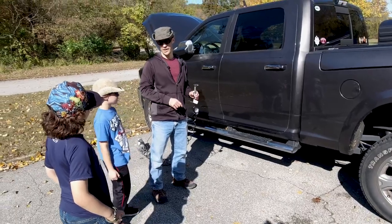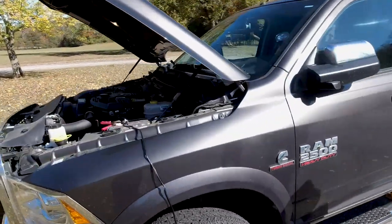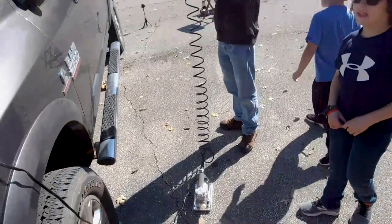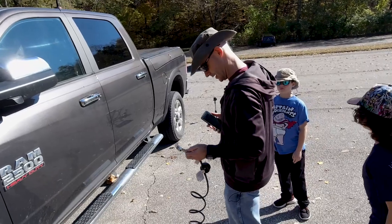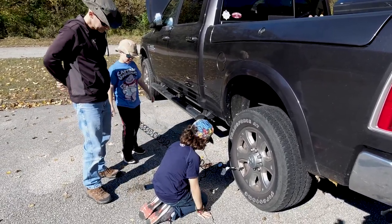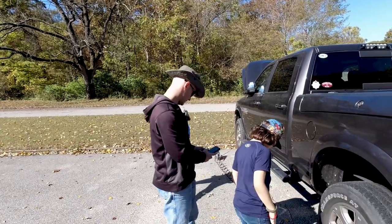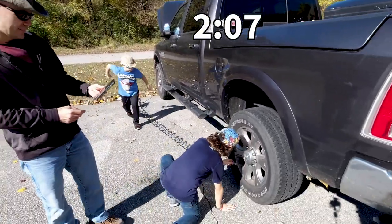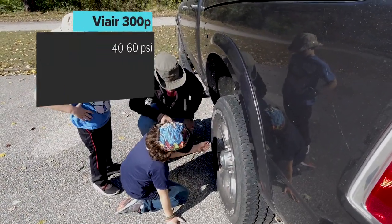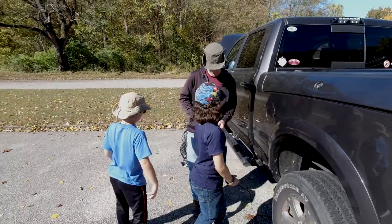Now we're using the 300P. You'll notice we now connect directly to the battery posts. We have a shorter cable for the electric side, but a much longer air hose to connect to trailer tires or whatever else you need. We peaked at a temperature of 113 degrees. We're about two minutes and seven seconds - two minutes, give or take some fumble time. So two minutes to get from about 42 to about 64 PSI. That's pretty good.